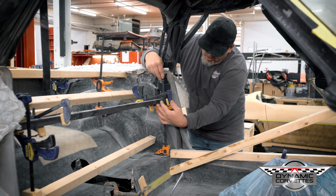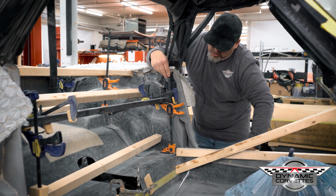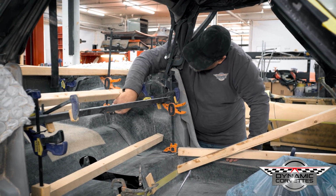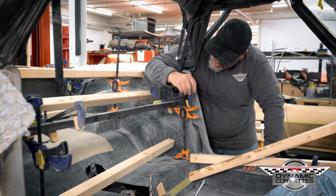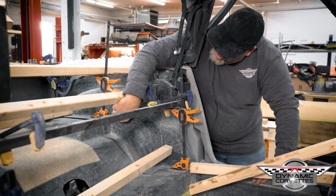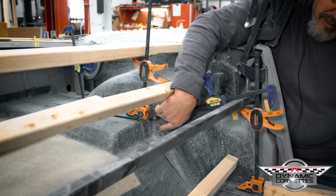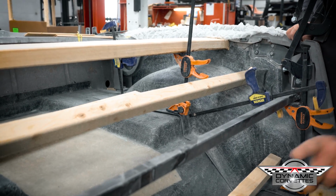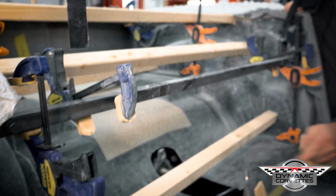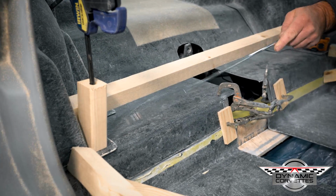Sometimes if you have a board, it'll end up being too long because of the epoxy taking up a little bit of the space. And if you don't happen to have those style clamps and you have just the normal ones where the ends don't remove, you actually can turn the clamps around and just run the clamps backwards. And if the clamps are too short, you can even just take a small block of wood, like right here, and drill a hole in the end of the block and put it in there.